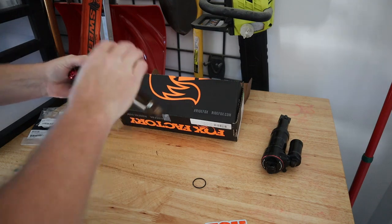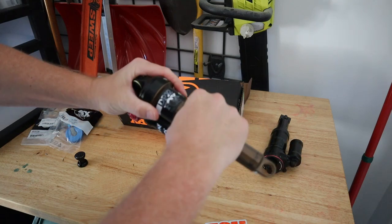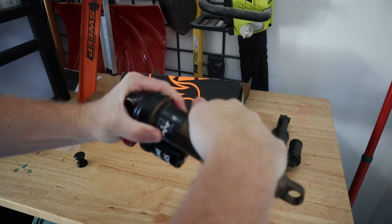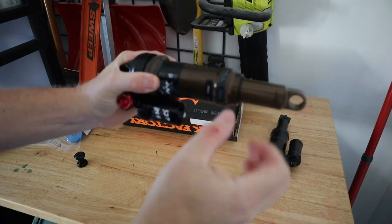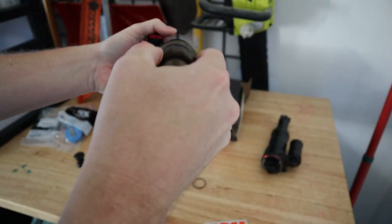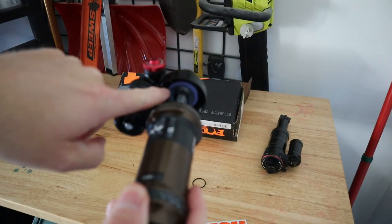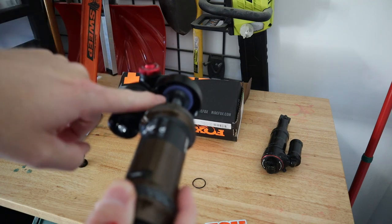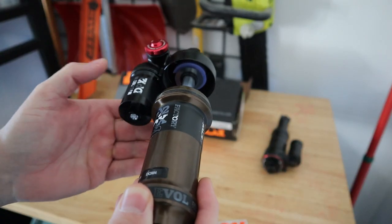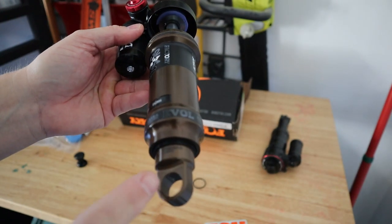It's always easier when you're unscrewing this canister to press in toward the threads, because it has a natural kind of vacuum. Grab it down at the bottom, and once we have the threads, it'll naturally move down, and we'll pull it down, and we can see that it looks like there's a purple spacer in there. Let's see if you can see that. There's a purple spacer in there. So I want to go see what the compatibility is and what the reduction is there, and possibly change that out before we press the bearing mount in the lower.